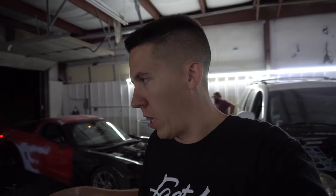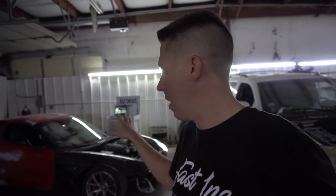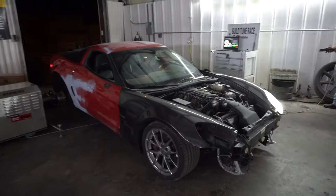The car should have made about 505 unless they were underrated a little from the factory, so I was figuring this thing would make around 430 on a hub dyno. It's about 15% drivetrain loss, but these cars are probably pretty efficient — drivetrain loss with the six-speed, the torque tube, transmission essentially in the back; that's how they're designed. I really wonder what drivetrain loss you get out of a Z06, because if it makes somewhere near the mid-four range just as it sits, that's pretty dang good.